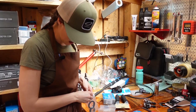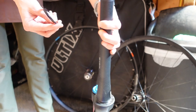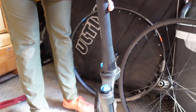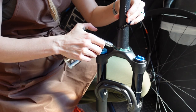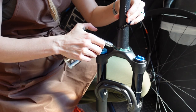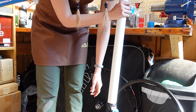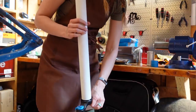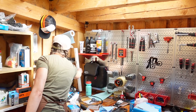I've done this a couple times but I'm not quite sure I'm remembering correctly the order of operations, but I think we're going to put the Crown Race on first — that's the part around there. You just put it on there and bang on it. I thought it was more sophisticated than that. Maybe put a tiny bit of grease on just because it decreases the likelihood of it creaking. You can also install your Crown Fork Race with a piece of PVC, which we did for years. Pretty sure we only bought the Crown Fork Race Installer because people yelled at us on the internet, but honestly I don't know what the downside is — it was fine.